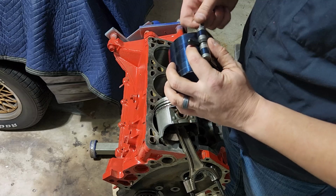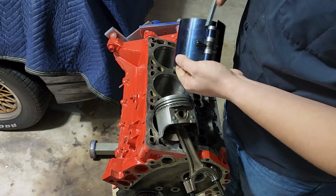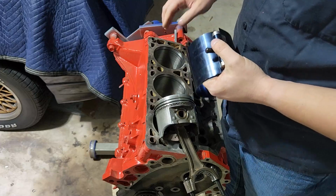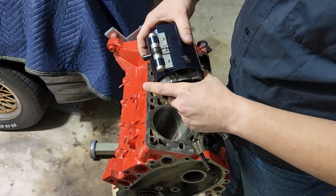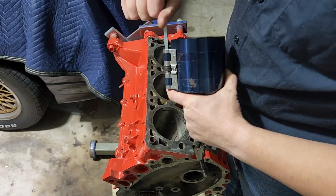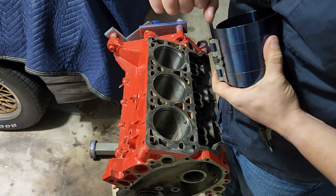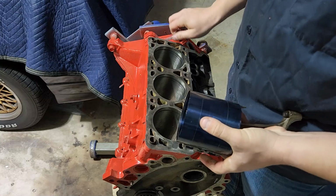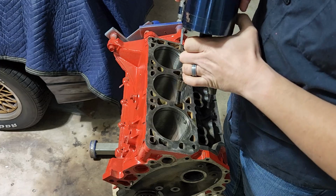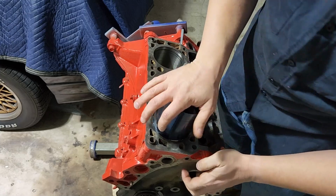There, loosen this up a little more. The way you loosen these up is you push down on that little knob and you can rotate it back and loosen it. And let's see here. So I'm going to slip this over the piston. Stick my little tool back in here. Tighten it down. Like I said, we want it tight enough to compress the rings so that everything will sit in here flush. And remember, the dots go forward in this application.